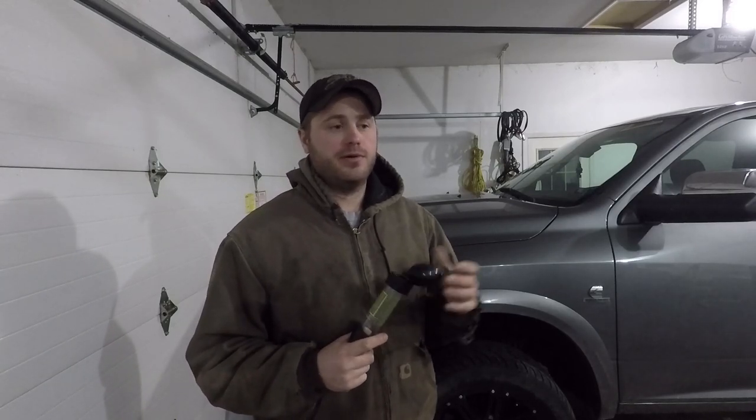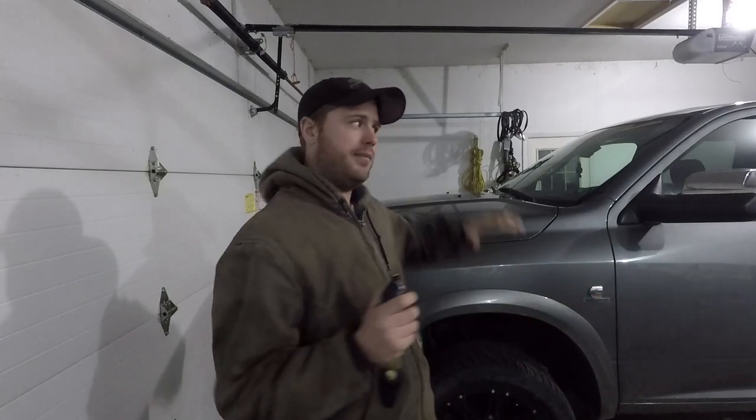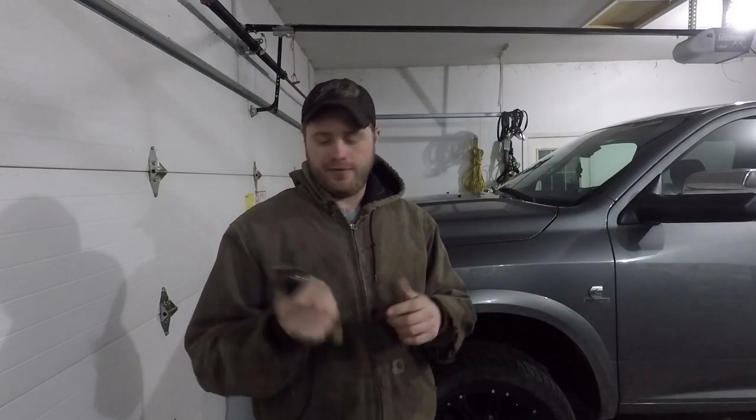The other thing I don't know about with a diesel — if you're running 70 mph down the highway, we're seeing 8 to 10 pounds of boost with that 467 charger. A vehicle that is not turbocharged, those are the conditions you're going to get. Your cylinder pressures will be higher when running versus idling, but I don't know that the boost is as big a factor. When we lay into it to pass somebody, we shoot up to 30–35 pounds of boost — with this charger, max I saw was up to 50. That's a very different scenario than sitting in the garage idling. If there was a way to have this tester on there while actually running the truck down the road, you'd really see a difference.